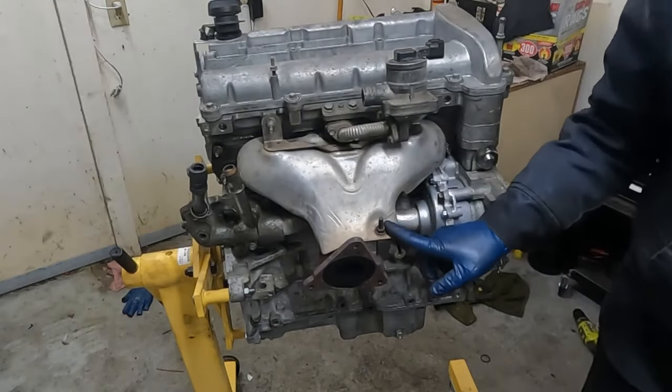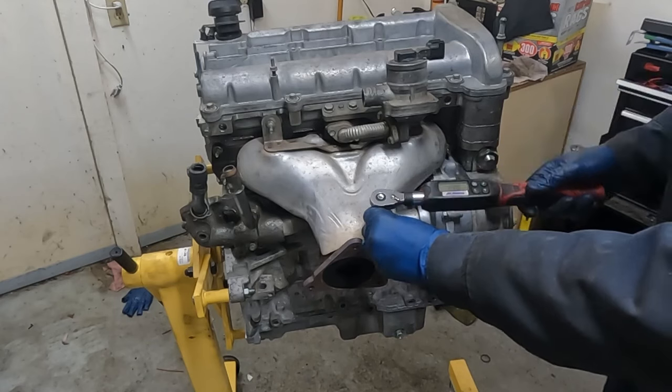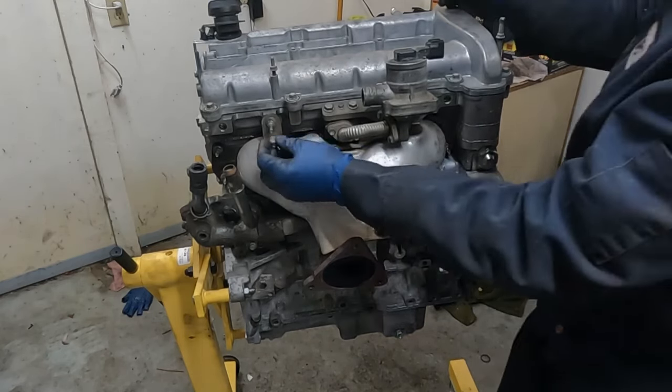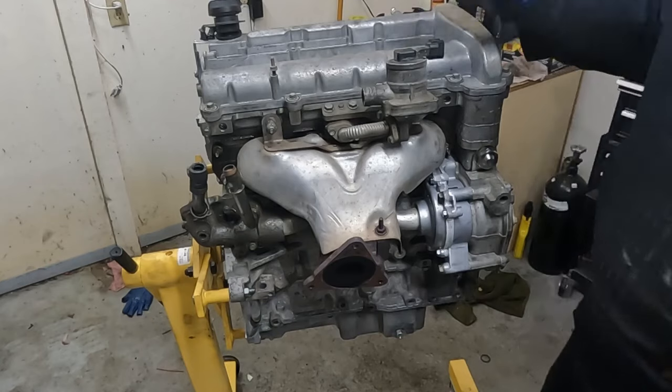And this is different torque. I don't have the torque on this heat shield. Well, I guess this is 18 foot-pounds too, or 17 according to the manual. So we'll get it close there. There we go. And this is the nut for our pipe that goes here, just for the bracket. We'll put that on so we have our eyes on it. So I think that buttons up this side.